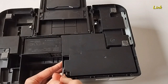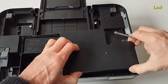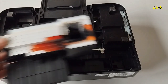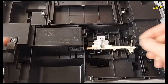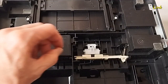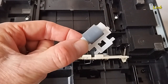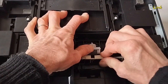Remove the screws to access the paper pick-up roller area. For more information on how to clean it, you'll find a link in the description. Here you can find the paper pick-up roller. Remove the spring and pull up the paper roller. Reinstall it in the same way and reinsert the spring.